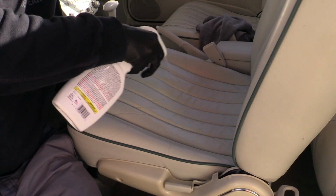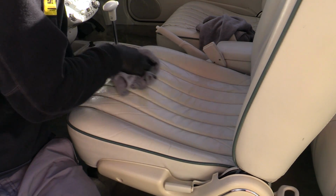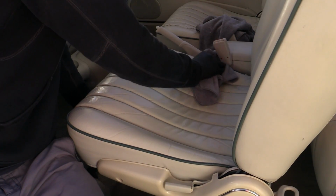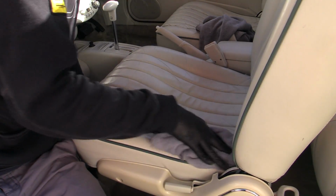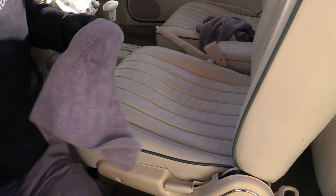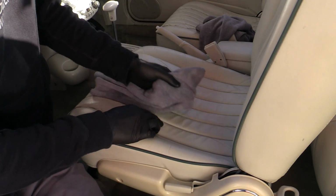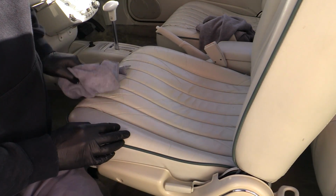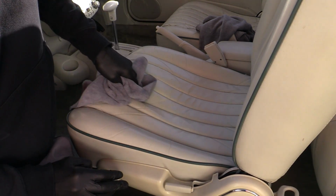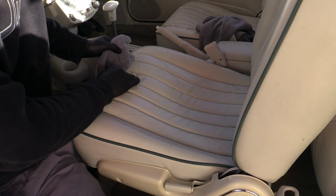Now, you're not really supposed to dress leather, but once old, unprotected and neglected hide like this has been given a deep clean, it can become tacky, dull and lifeless. Therefore, I find an all-encompassing solution like this is the most efficient and realistic way to finish it all off without spending hours sealing or conditioning subpar leather that won't thank you for it. Yes, you'll have a bit of a sheen on your seat and it might feel slightly slippery on the backside for a few days, but that's the price you pay for either letting your leather get in such a state or buying a car in that kind of condition.